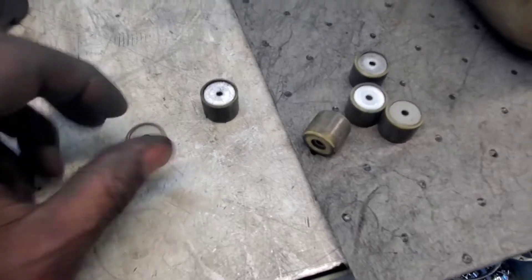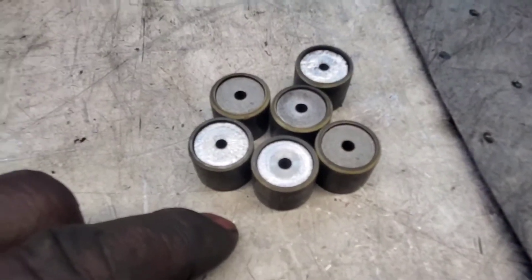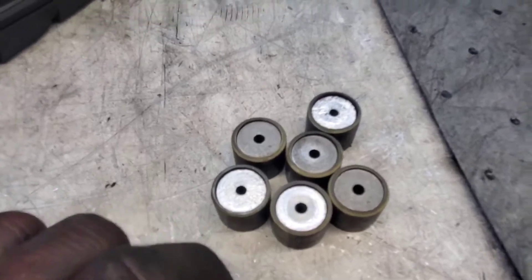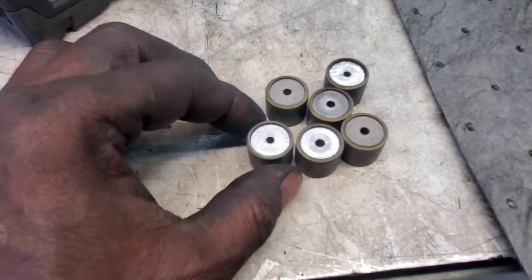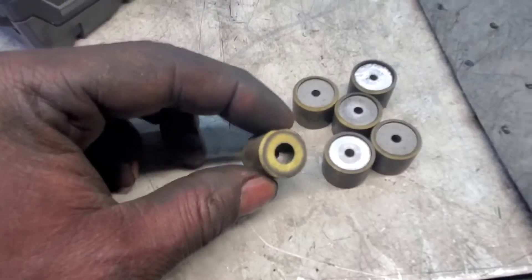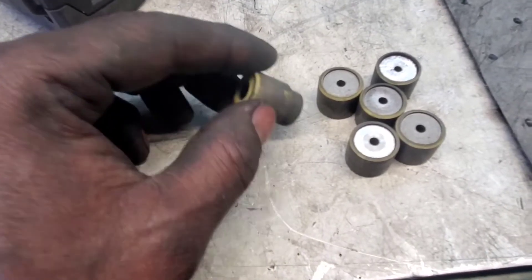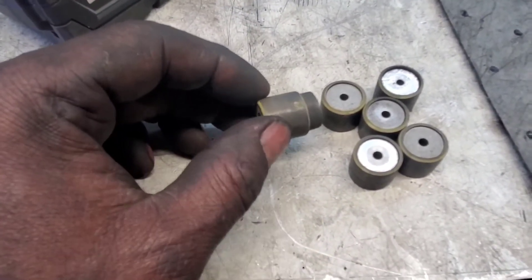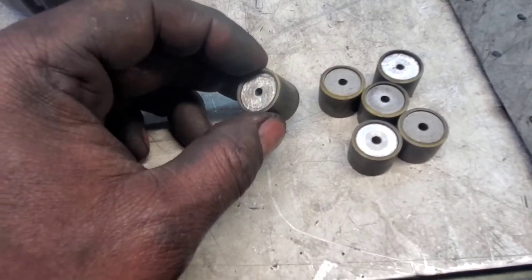When I took the front variator apart, these are called roller weights and they are in the front variator of your scooter. Somebody has gone through the trouble of machining these roller weights. I took good ones that I have, put them in, and took these bad ones out. The reason I took these out is because typically this roller will look like this, not like this. The problem we have with these rollers is the inner sleeve drops right out. And as they roll around in the variator, I'm convinced that they're getting stuck on the wall and the clutch is unable to perform.